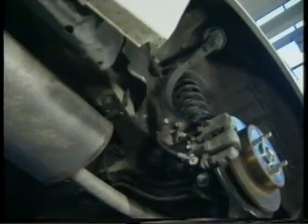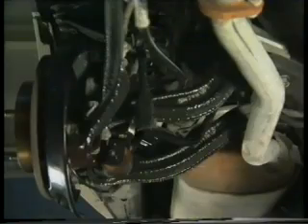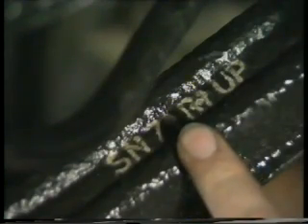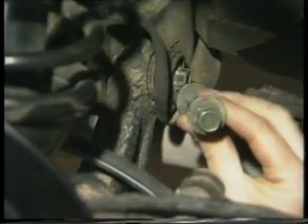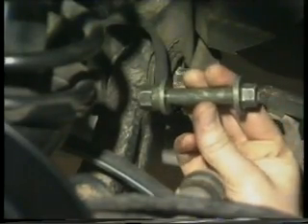The unusual length and shape of the rear knuckle allows the upper arm to be located further outboard than normal, which as a result allows for a larger boot space. The upper arms are stamped with an L or an R to identify left from right, while the longer and shorter lower arms are also identified and must only be fitted in their correct positions. The inner fixing bolt securing the shorter lower arm features two offset flanges. The rear wheel alignment can be adjusted by loosening the nut and simply turning the bolt, which will either pull the arm in or move it out.